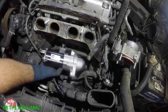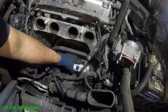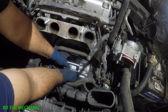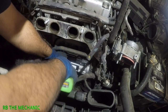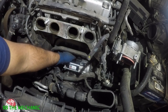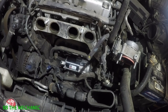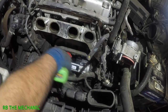I'm going to show you step by step — we're going to follow the reverse procedure. Put the starter in first, align it, then take your number 17 bolt which goes in here. Catch the threads. Once you have it snugged — I didn't fully tighten it yet because we still have to put the other bolt in. Make sure you put both bolts in before tightening anything.